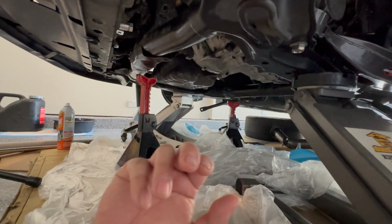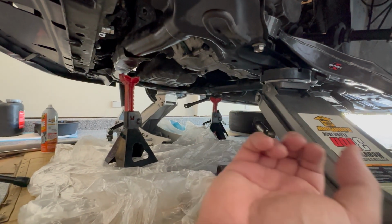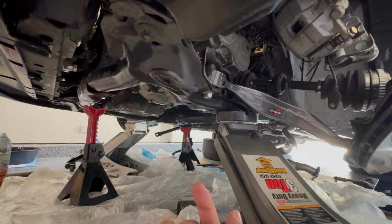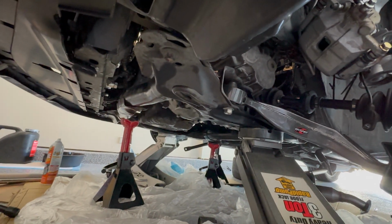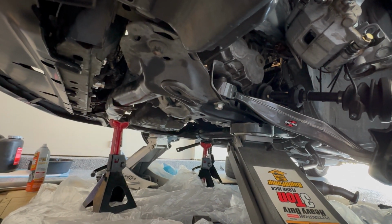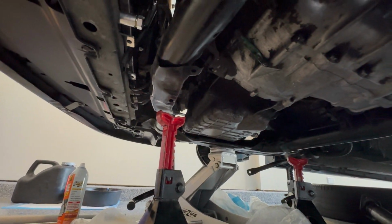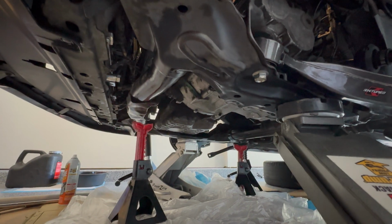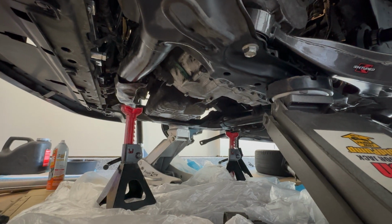Now, once I take out the four bolts, I think it's gonna drop. And then from there, we're gonna have to lower it, bring the jack stands down, and then just lower the floor jack till it hits the ground. That's the theory. I'm gonna do it now. I'm just kind of explaining what I've done to dismantle certain bolts to get it ready. And the reason why I'm doing that is to replace the oil pan, which I need access to the side of the screws where the subframe is covering. So that's kind of the next project, and I'm gonna just remove everything today and get it all ready.